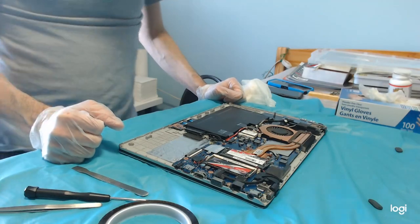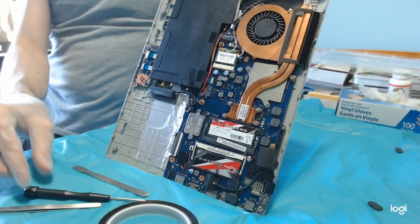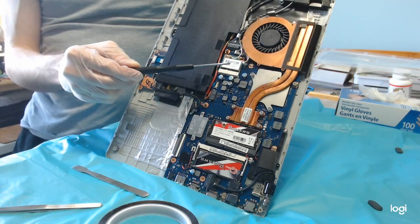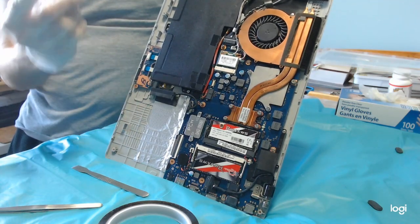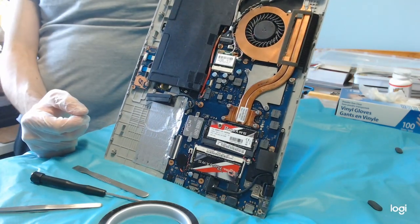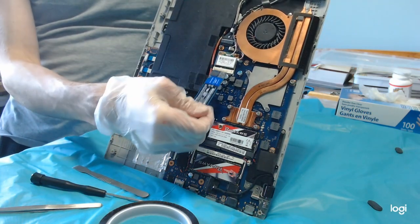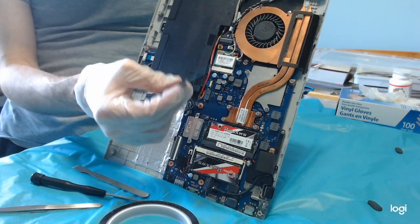Now, how are we going to do this? You see this? This is the Wi-Fi card, which is plugged into a mini PCI Express slot. This is actually a second generation mini PCI Express channel 2x, which means 500 megabytes per second. It's going to be faster than SATA, than the primary main drive. But this is different. This is NVMe M.2, while this is PCI Express Mini, with a different connector and size, but the channel is the same technology, so they are compatible.